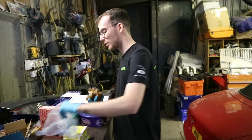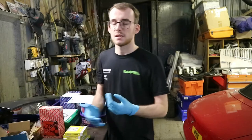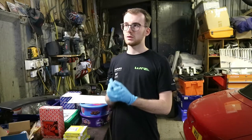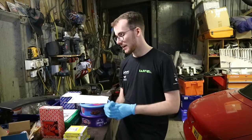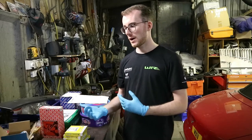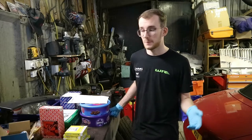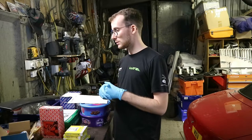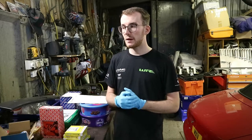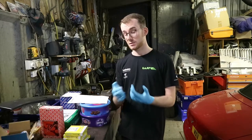The problem with these engines is there are different TU3 generations. This is a TU3S, which came in the XS — it was carbureted, a 1.4, and a very pokey little engine for the time. Very minimal electronics, very mechanically sound. You can push probably about 130 to 140 brake horsepower out of them, but you have to do a lot of work for that.